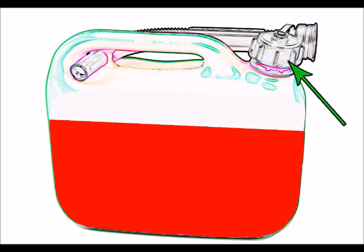There are ways to combat this, like keep the fuel tank cap nice and tight to make it last as long as possible. That's something that I hear some people have had success with. And when we fill the cans full of fuel, it's apparently best to fill them to the top, particularly if we're storing them for a while. So there's no space here at the top, because if there's space here, then there's space for the reactive substance to evaporate into. And of course, we don't want that, but filling this gap is supposed to reduce the evaporation.